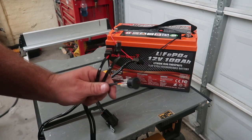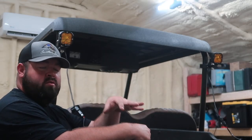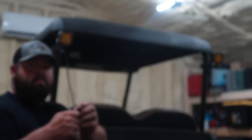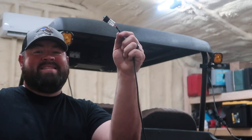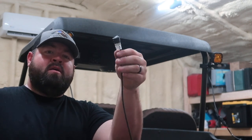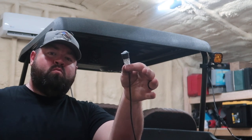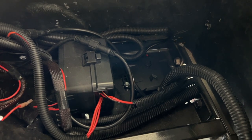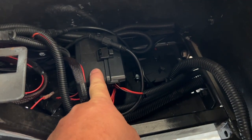The light connectors for the light pods are about nine to ten feet in length. I have both light pods connected to the wiring harness, which goes to the relay and battery, and the switch turns them on and off. On our install, since we're using their 16-LED light switch and everything is controlled through the 16-gang switch, I'm not going to use their wiring harness or relay — the 16-switch already has relays built in with the fusible links. The relay box is mounted directly on the driver's side where we can access the relays and fuses by pulling the cover off.